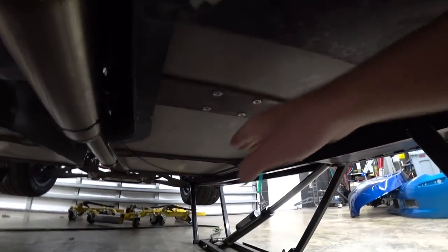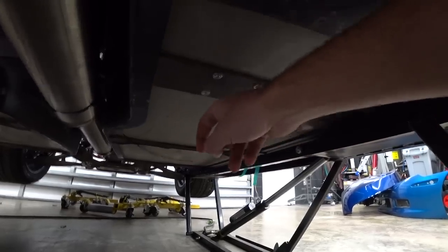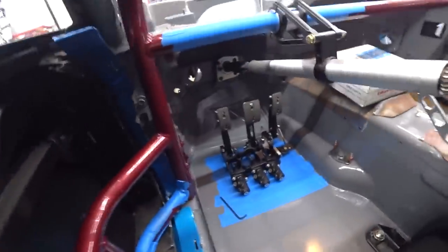For the pedal box floor plate, instead of welding nuts on the back side, we recessed the nuts into the plate. On most cars the frame rail is below the floor, so bolts sticking through aren't a problem. But here the floor is the lowest point — a bolt sticking way below would be unprotected and could get smashed. Recessing the nuts keeps everything tucked up as high as the brace. After some grinding and welding, the pedal box is done and dusted.